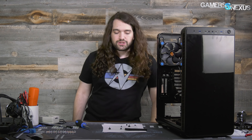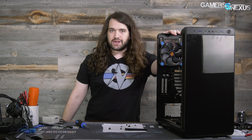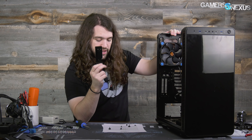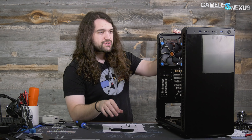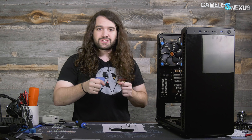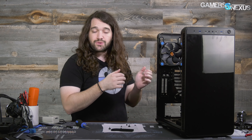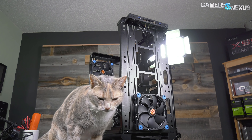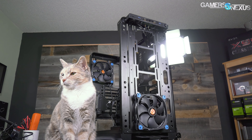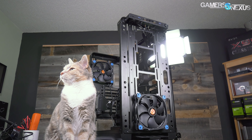The reason it takes so many screws to get off is because you're lacking a structural support beam. When the panel is on without that support piece — which wasn't in the CES unit but has been added — it has four screws going over the back corner. Without those extra four screws, applying torsional force to the chassis can actually cause it to bend and warp, losing contact between the acrylic side panel and the front and back. Fortunately they've got the extra screws in there, though it is still a bit structurally weak in that corner.